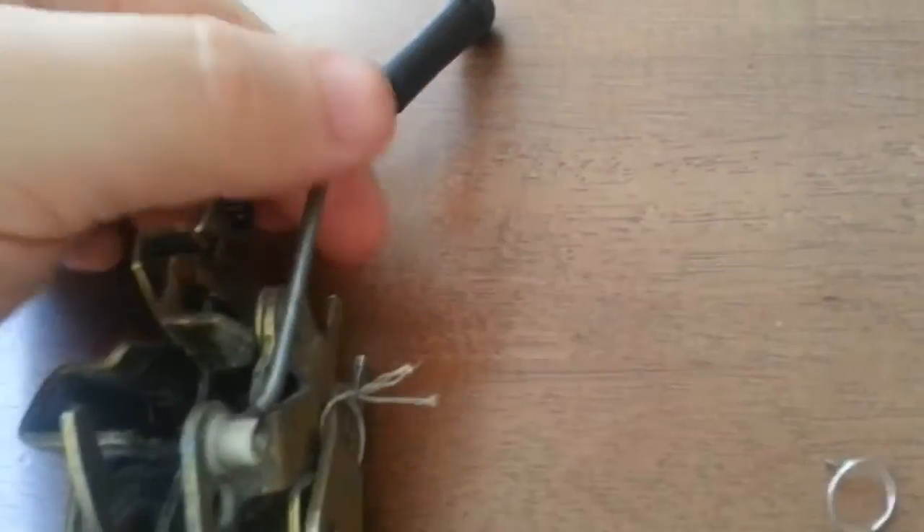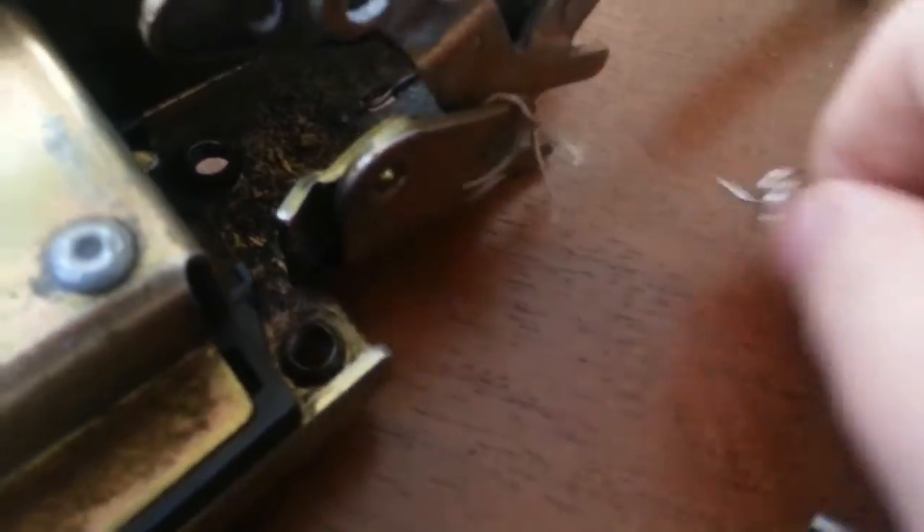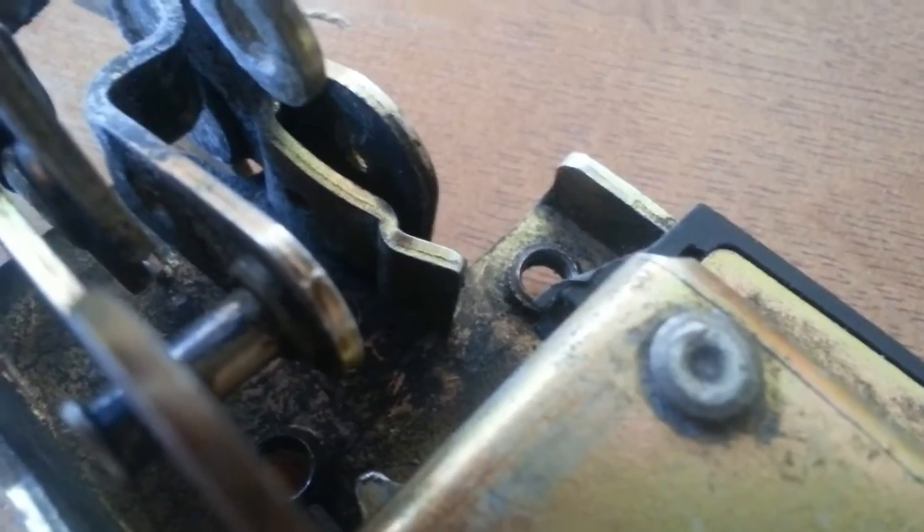...this is the bit that is your door lock — you know, when you pull on the door. This spring fits between this hole. There's a tiny gap. This is a very common fault with these Volkswagen locks. Let's go right in there — can you see the other hole?